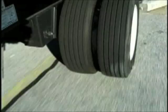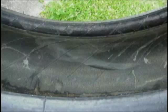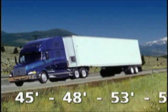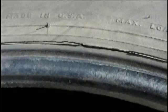Pinch shock damages are primarily seen as trailer tire damage. However, all wheel positions on a vehicle have the potential to experience a pinch shock condition. As the length of trailers increases, so does the potential for this type of damage. Pinch shock conditions are often confused with guide rib or chafer separations. The way to distinguish between the two conditions is that pinch shock tends to be a localized damage often accompanied by abrasions and cuts in the sidewall. Chafer separations tend to be more circumferential in nature and are associated with casing fatigue.